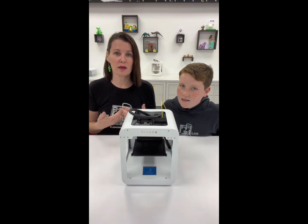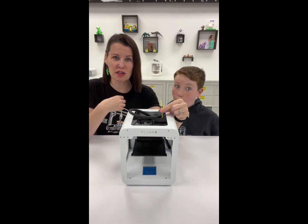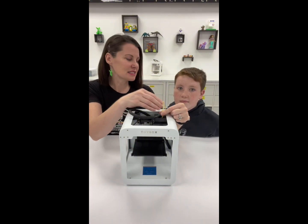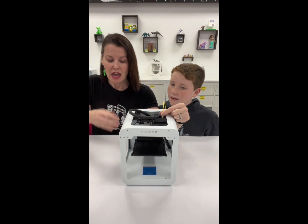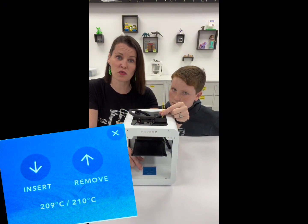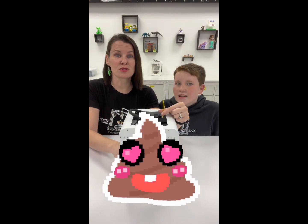While it's warming up, you're going to see a warm-up circle and you're going to wait for that circle to complete. It's going to show two arrows: one for insert and one for remove. What I always suggest is what I call a pinch test — you're actually going to pinch this food up here firmly with one hand, and with your other hand you're going to push the insert arrow, the down arrow. The reason I call it the pinch test is that's what I'm doing to feel the machine vibrating and sucking in that food so that I know it's working. At that point you can let go, but you are going to have to hit insert every time the arrow lights back up — it will gray out when you touch it. You're going to hit it over and over until you make printer poop.